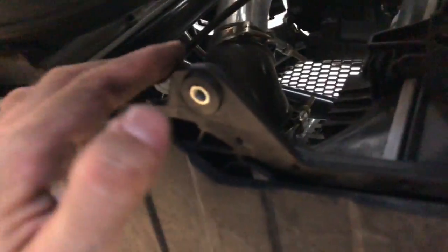One thing you can do, if you have an 845 intercooler kit, let me show you what you can do here to alleviate that issue. This plate's in the way, of course, but the lower bracket on the 845 cooler kit, can you see it? I can't see anything. Anyways, it's somewhere in there. You just pull the lower bracket mount off of the intercooler so the whole intercooler can sag down a little bit. And that way you don't have to remove the piping.